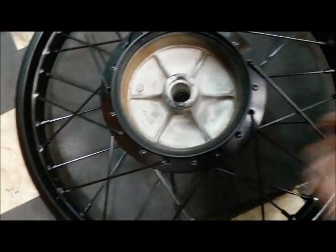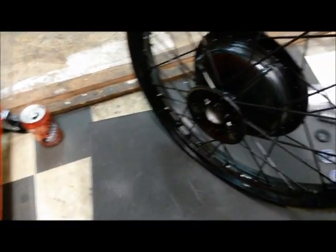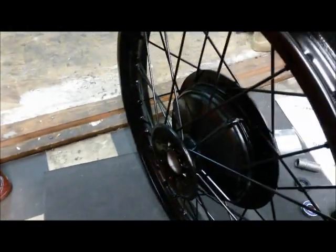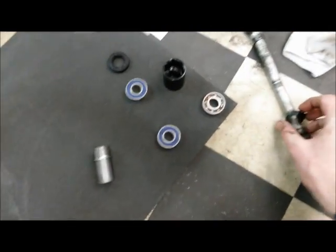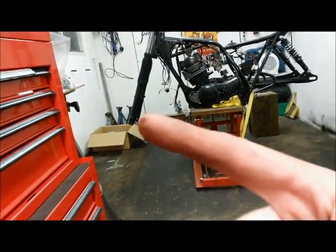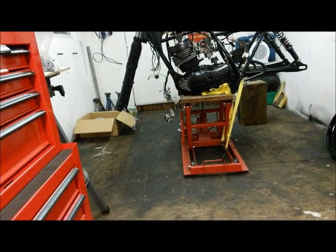and I'm pretty clear now. So looking at the wheel on the brake side, in this side we'll put the bearing and an oil seal, then we'll put the spacer. The metal spacer in the middle goes in before we put the next bearing in, and then that's it. Those bits all slide together then. So I'm pretty sure that's it, but once it's all together I'll quickly throw it up on there just to see that it all sits as it should.